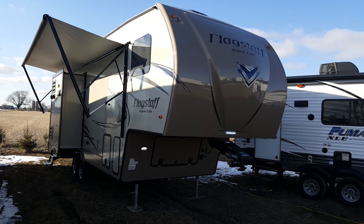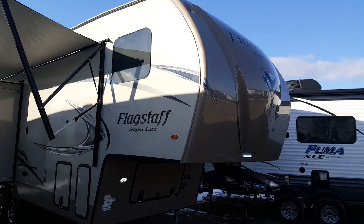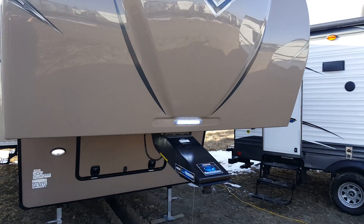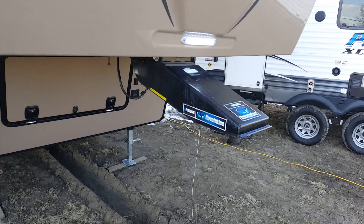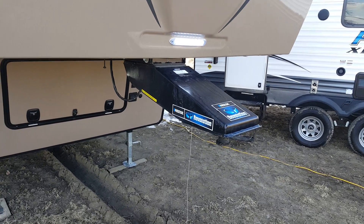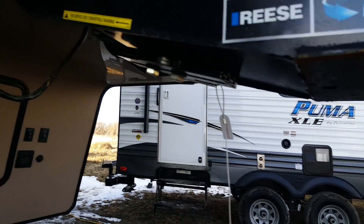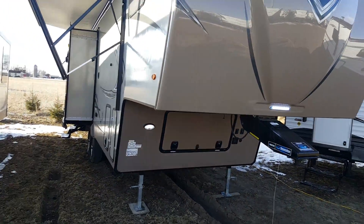We ordered this one in the champagne exterior. It has a two-tone look — the front cap is a little bit darker and it's a one-piece fiberglass cap with a built-in LED strip light down below, plus marker lights up above. It's also got the Reese Revolution pin box, so with that pin box you can use it on five-and-a-half foot boxes without a sliding hitch. A couple bolts get removed and it pivots back rather than at the front, giving you a better turning radius so you don't need a super glide or auto-slide hitch.